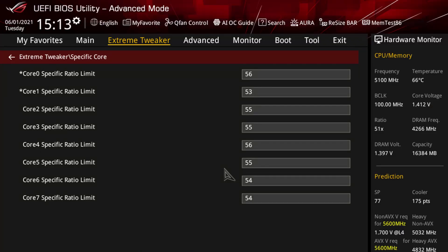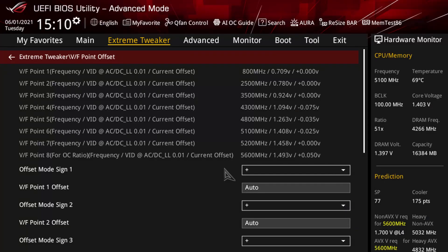The per-core ratio limit, which is a new feature on Rocket Lake, really helped by allowing me to restrict weaker cores from boosting to frequencies they couldn't run stably. That's a big improvement compared to Comet Lake, especially for upper frequencies like 5.6 GHz. Tuning the voltages with the VF point offset gave me an additional 100 MHz in multi-threaded heavy workloads. I'm particularly happy with those results because it gave me a true appreciation for the power of undervolting specific VF points, especially when constrained by power usage or temperature.